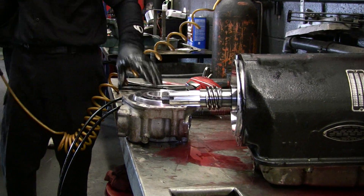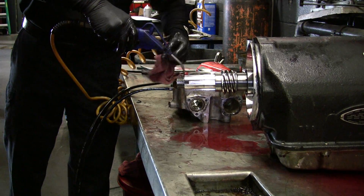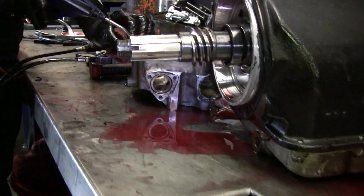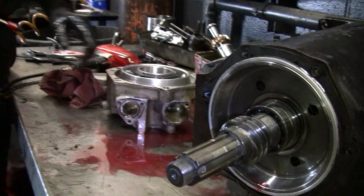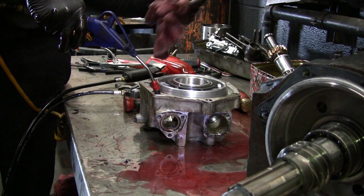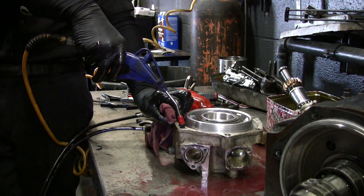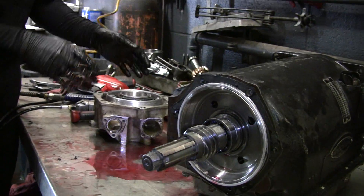This car is a 1960. So one of these passages is the apply. Fluid comes through one of these ports — this one right there. When you go to put it in reverse, it actually goes through this tube here, the tube that I pulled off, and it uses fluid pressure to apply it. You've got to cover the return one otherwise you get a face full of fluid. You can see there's leakage — there's always leakage — but with it running and constant pump pressure building, it's going to hold it. So that's your reverse cone assembly.